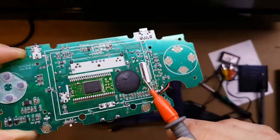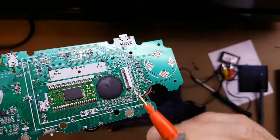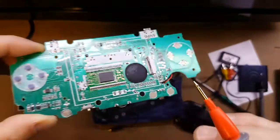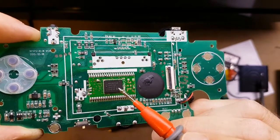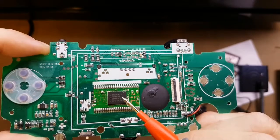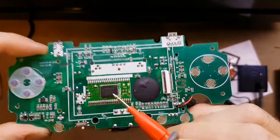So I don't know what that's all about. But we can see from the track layout on here, the integrated circuit under here is going straight to the LCD connector. The brain of this thing is actually an Intel chip — let's see if I can focus that for you. Yep: 6600M0Y0UE, Intel integrated circuit. I can't get any information online about it really — most of the websites are Chinese, and the only datasheet I can get I'd have to pay for. It probably costs the same as the whole damn thing cost. There's very little else on here — quite a few zero-ohm resistors, links, a few passive components, and that's pretty much it.